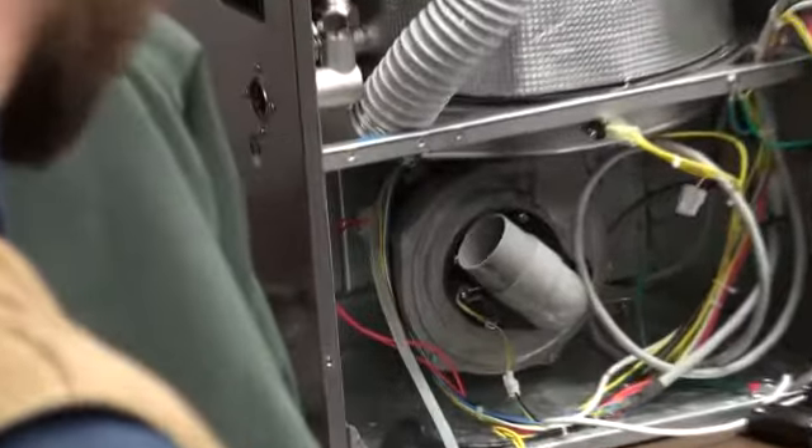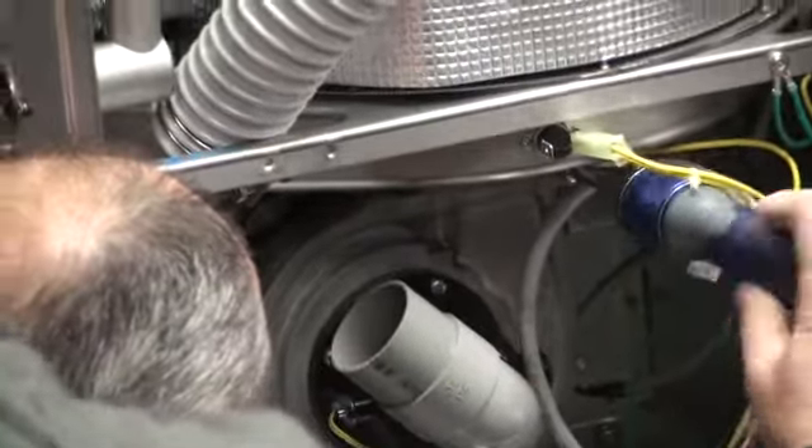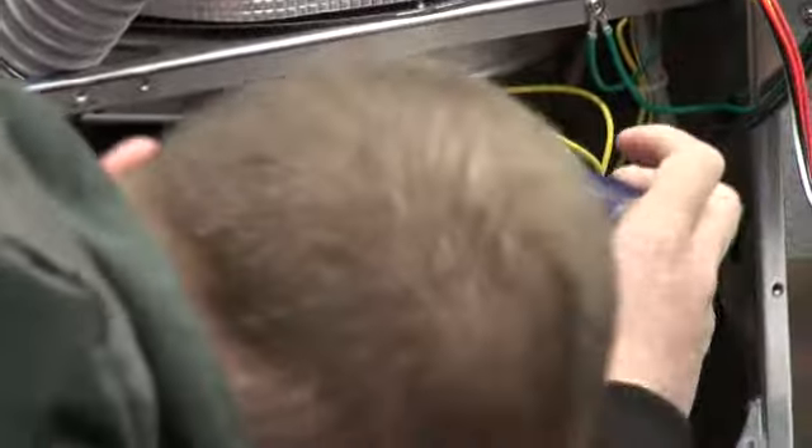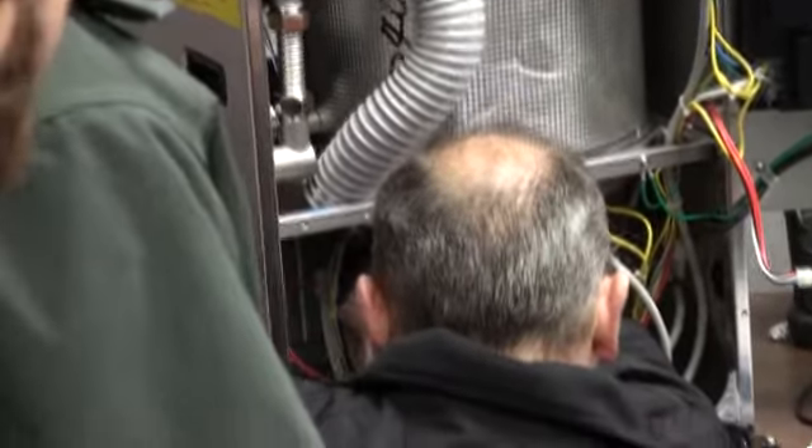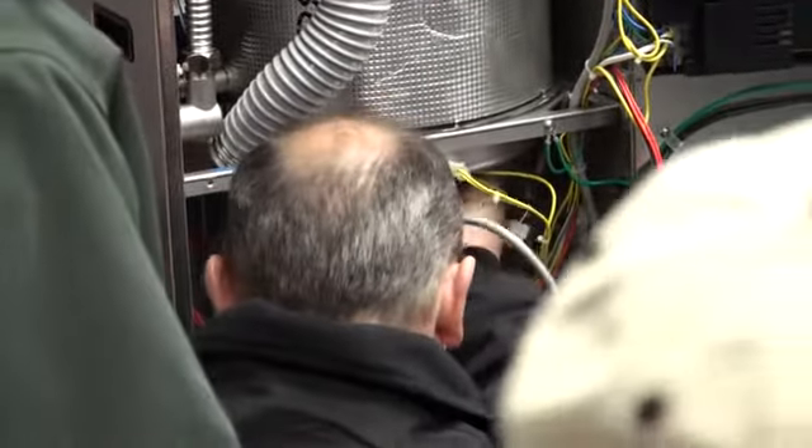Alright, now look at your fan where it goes up into the bottom of the machine. On the bottom of the heat exchanger, you're going to see a Phillips head set screw on that fan - top right-hand side of the fan. Loosen that set screw about six turns and you should be able to spin that fan to the left and drop it out of the machine. If you can't spin it, you're not loose enough yet. Loosen a little bit more if you can't drop it.